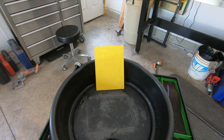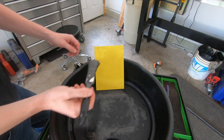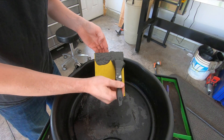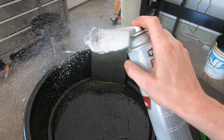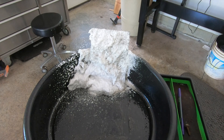The way I'm going to conduct my dirt testing is I have a metal panel that I stripped down, sandblasted, and then spray painted bright yellow. What I'm going to do is paint the surface of that test panel with that dirt, then spray each product on the panel, thoroughly saturate it, and let the panel sit for two and a half minutes with the product on it to let it work.